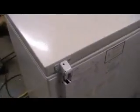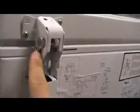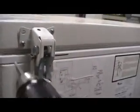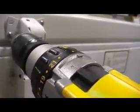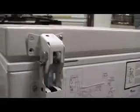To get the collar on, we have to take the lid off. Come around to the back where the hinges are. If you have springs integrated into the hinge, you'll want to lock that out — for the Whirlpool it's done by inserting a nail into this hole here, so when you take your screws off the hinge doesn't pop open under the weight of the spring. I'm using a cordless drill driver, and these screws are square drive or flathead, so just take all the screws out and the lid will pop right off.